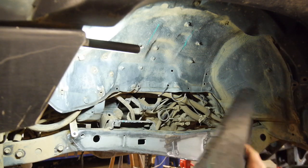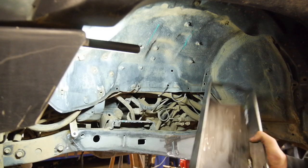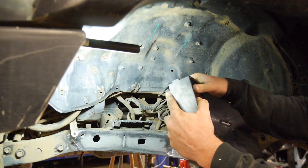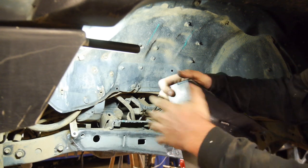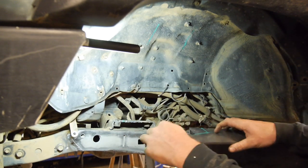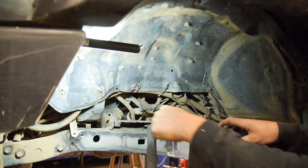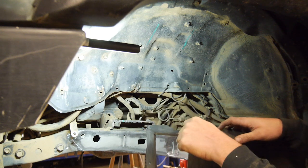It's time to start looking at coilover towers. I've just tacked this one together — it's quite a beefy boy. There's also this bottom section which Troy has designed, which by the looks of it is for a bump stop. I probably won't be able to use this, so I'm going to leave it loose. I'm probably going to end up cutting a lot of this back because I think I'm going to have issues with the flip radius arm mounts hitting.